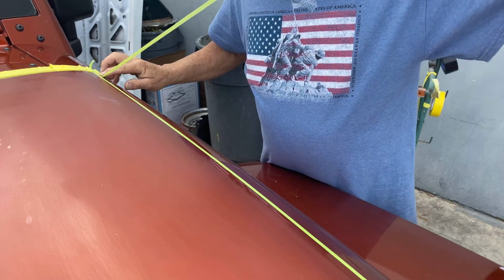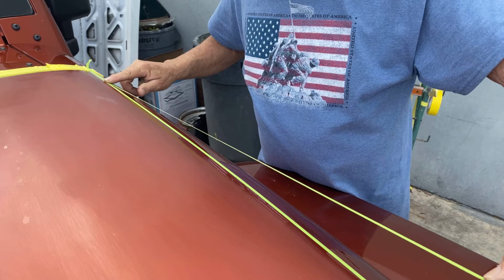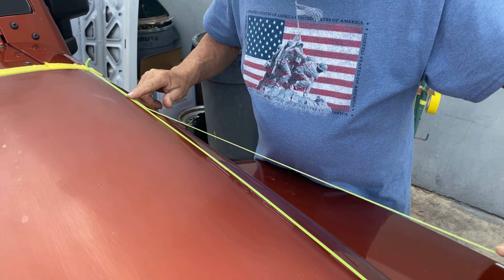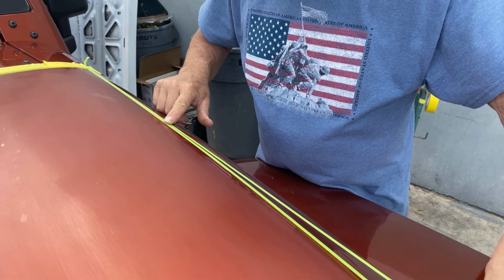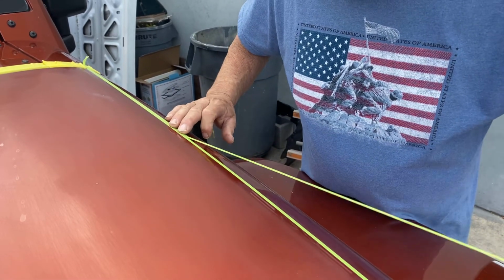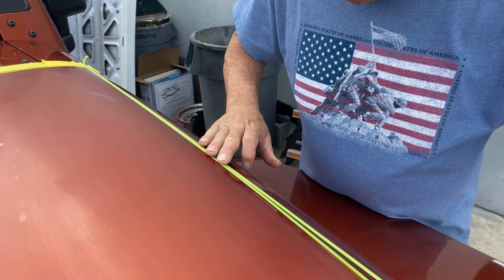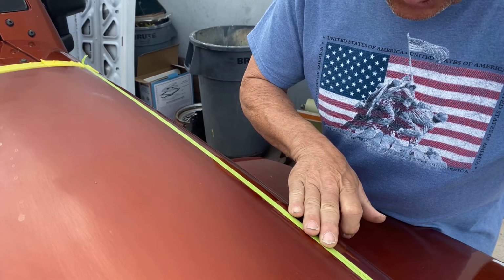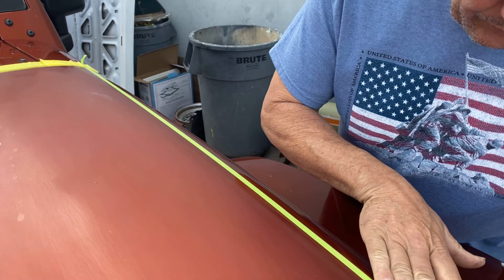This tape stretches a little bit when you rip it, so I've got to compensate for that stretch. Anyway, over the years, you're going to find out masking is not as easy as it looks. To lay out a nice line is extremely difficult. Your arms waver, your eyes waver. So the steadier you can be by stabilizing your hand, the better off you are.